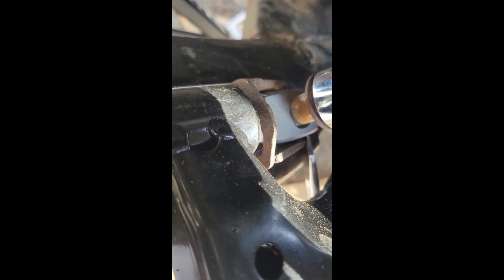So what you really want to do is hit it up while you're trying to tighten it, so that this is no longer forcing pressure on that side, and it's even. If you could hit it with something while your friend tightens it, it would probably be the best. Someone would spin it while you repeatedly hit this, so that it can find itself into the hole. And you want to get it started properly. You don't want to force pressure down on that and try to force that in there, because you might strip it, bugger the threads, and you don't want that, because it won't be able to go in the hole ever after that.